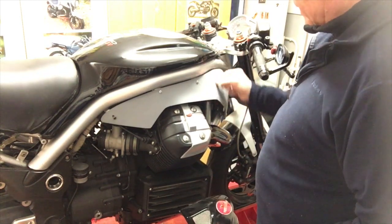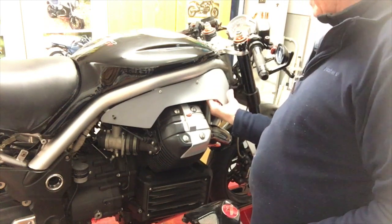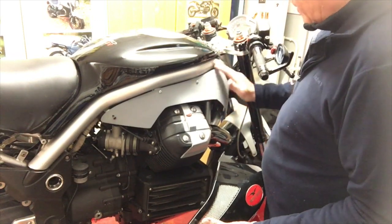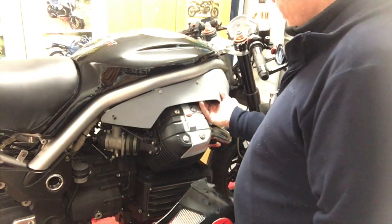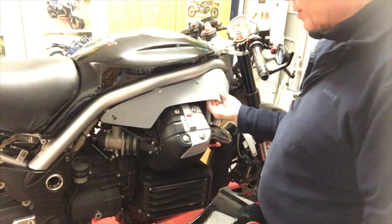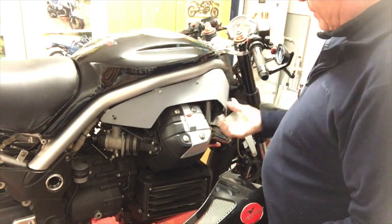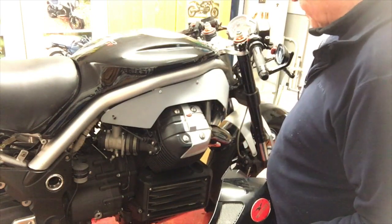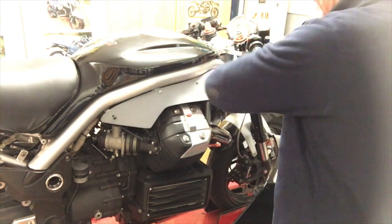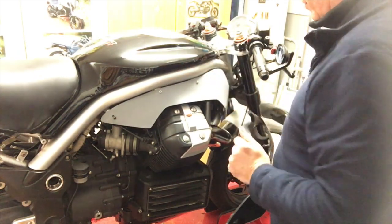I had to put that fold line there, which looks okay, but that's because the ignition coil was behind there. So I couldn't hug tightly to this side of the frame without resiting the ignition coils. But there's not a lot of room under the tank. They've got to be somewhere that's protected from the weather. But I think what this illustrates is there's much more room now for the clip-ons to actually get full lock on without hitting anything.